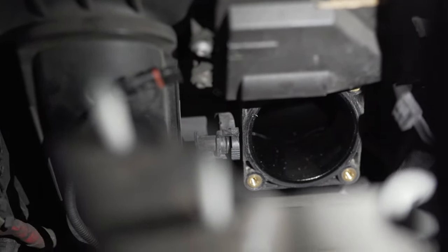That's the sound you're supposed to hear after this job is done. Only after you start the car can you clear the code for the starter operation from car access system. This is it guys, I hope this video was definitely helpful to you. This is how you do the starter replacement. Just a reminder: after you do everything, if you have a scanner it's best to check DME codes because if you forgot to plug something in the code will appear right away. Thank you guys for watching, see you next time.